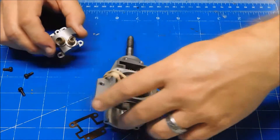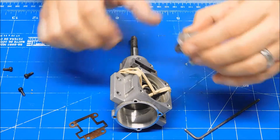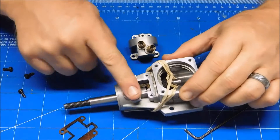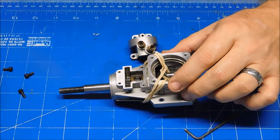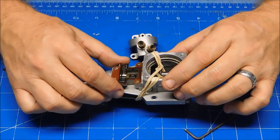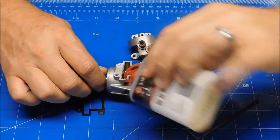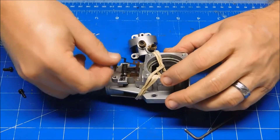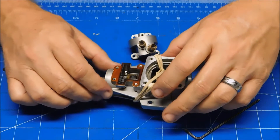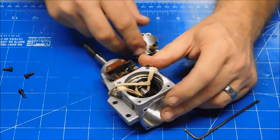So now all I have to be conscious of is making sure that my timing dot stays at the six o'clock position. I've got a little bit of oil here on the mat. What I'm going to do is first put my gasket on here — that's going to need a lot more oil to kind of hold in place. I really want that gasket to be glued in place with that oil if possible. I'm just going to assume that this is going to keep my crankshaft at top dead center.